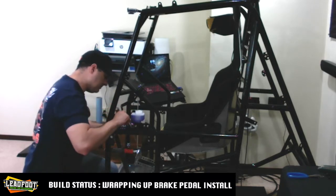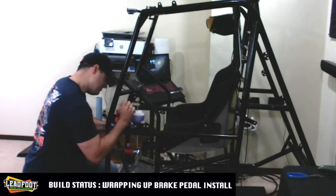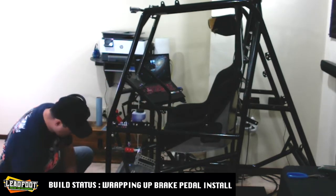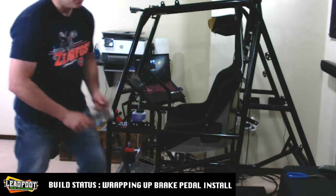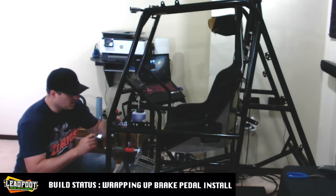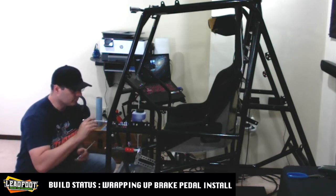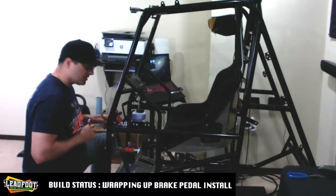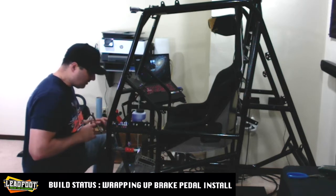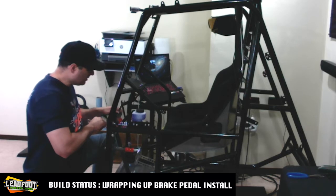Good. We are level. Beautiful. All right, we'll put our cap back on the master cylinder. Holy cow. We just about have it mounted to the pedal where we want it. Things are looking up. All right, and now we're going to attach the heim joint, which is attached to the brake pedal already via fastener. Then we'll tighten that fastener up. And I do have that heim joint sandwiched in between two flat washers, just a personal preference. You don't have to do that yourself, obviously.